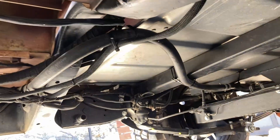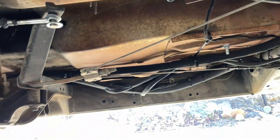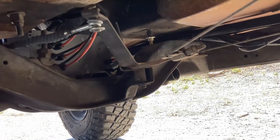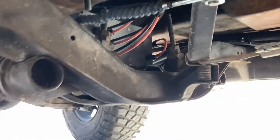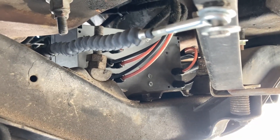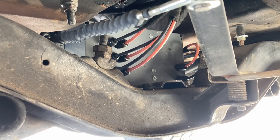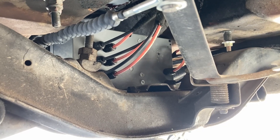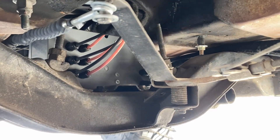You can see that's where the battery ends right here, and that's right where my cab starts. Right there is the high-voltage junction box. I have 400 volts coming from the battery pack back there to this junction box, and that junction box has three different things coming out of it: one 400-volt source for the heater controlled by a contactor and toggle switch, and the other two are going to the DC-DC and the charger up front. This is also where I have my high-voltage fuses — so in case any of those pop, I crawl under here and change them.